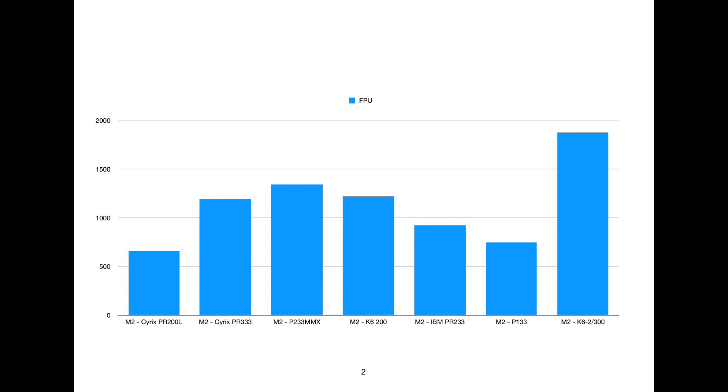It's quite interesting that the Pentium 133 really sort of keeps up with everything else even though it's quite a lot slower and doesn't have MMX. And then the K6-2 is way out in front. I've seen the K6-2 being a lot faster in quite a few of the benchmarks, and I suspect a lot of them do utilize that 3D Now. These sets of benchmarks kind of line up with what I'd expect the overall performance to be of the chips.